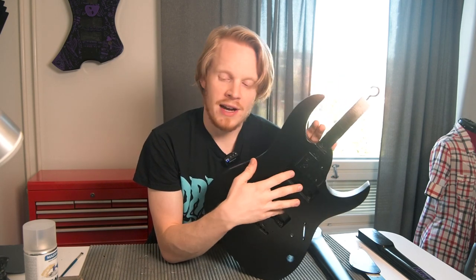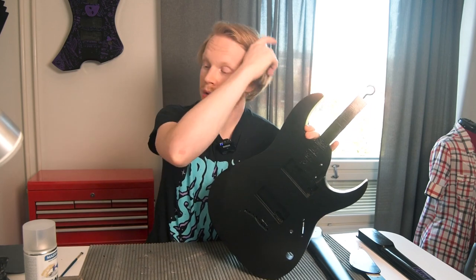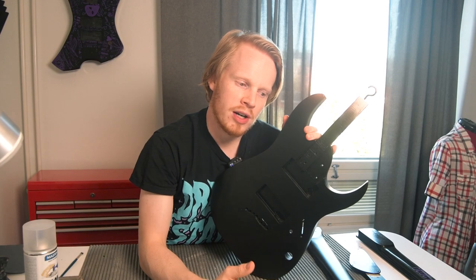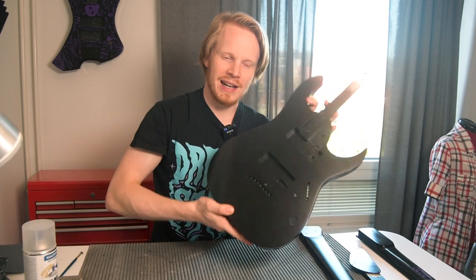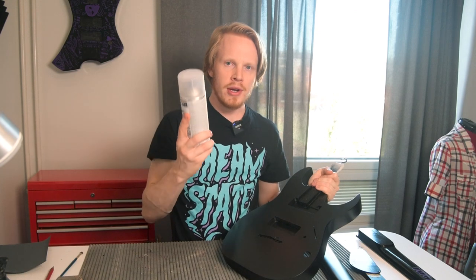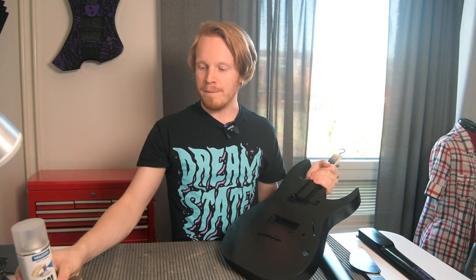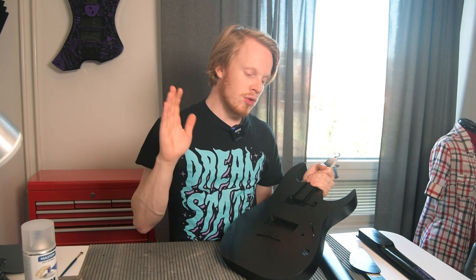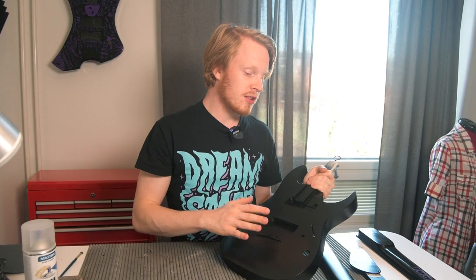And that's mainly for the sake of the fact that if I were to go and do all the wet sanding afterwards, I would have scratches, yes, but I'd also have to go to somewhat of a high grit, which would already give a sort of sheen that is similar to this satin that we have right now, and we want full matte. So the best way to get that is to just go straight from the can, and it's a little bit difficult to do properly, but if you're careful and apply good coats evenly, and do good prep work, so do your wet sanding or your scuff sanding very well, try and get it as flat as possible, you should be well in the clear.